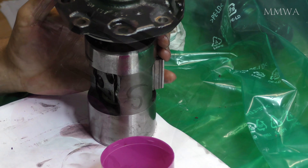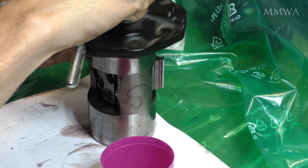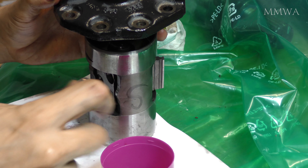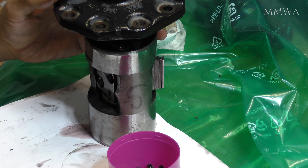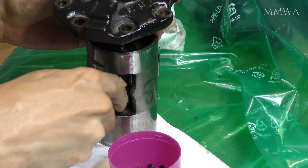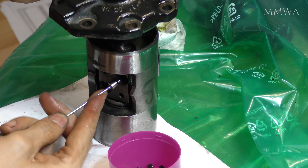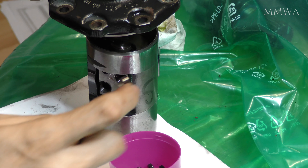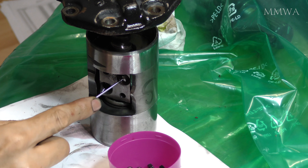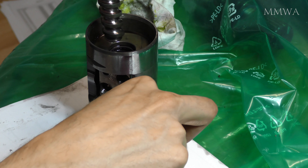They are all at a certain stage of wear, and you don't want to have new ones mixed with old ones. Here I am just getting the rest of those balls out while threading the shaft out of that steering nut. A high-powered magnet like this neodymium one is quite handy for this - I don't think these magnets existed in the 90s. It suggested using a bar magnet. This device I use for picking up screws was handy for this job as well.